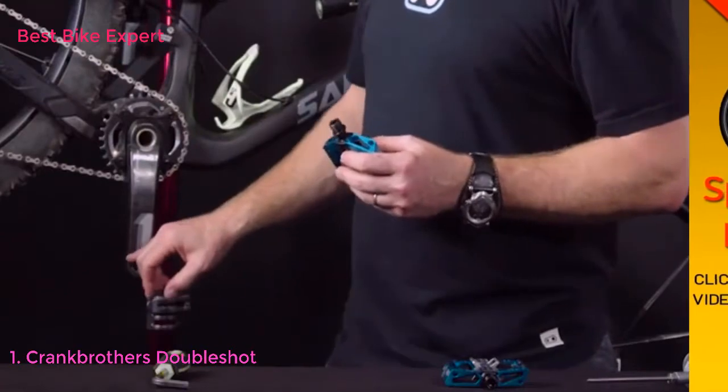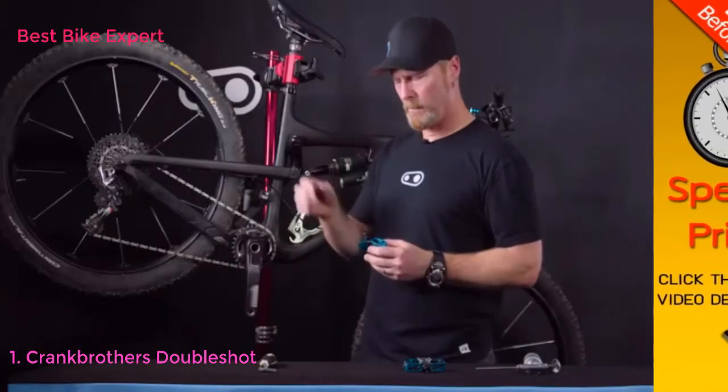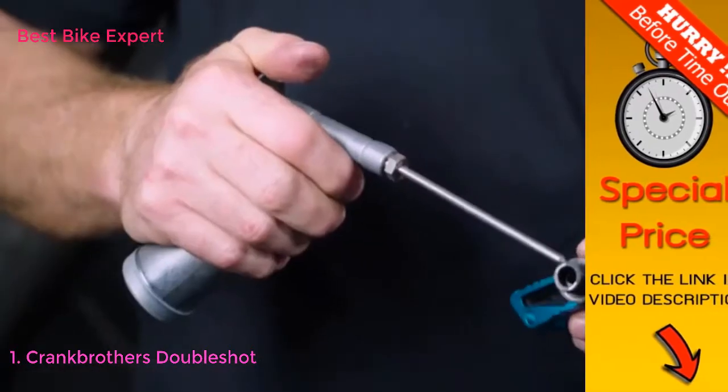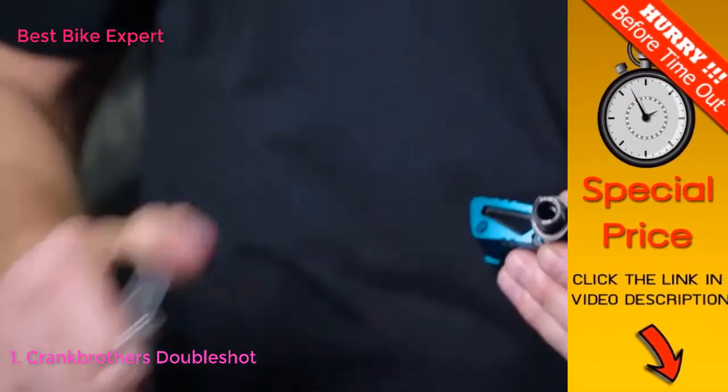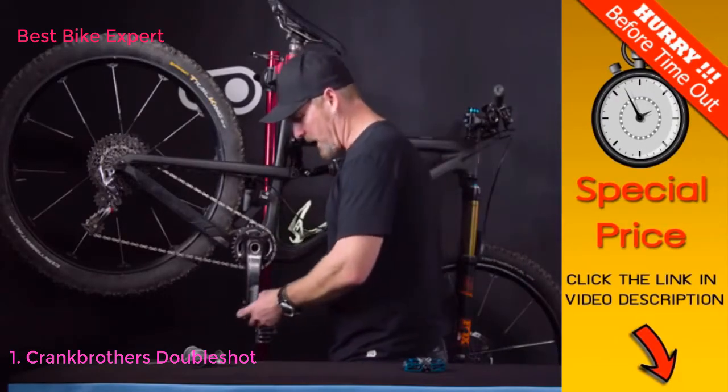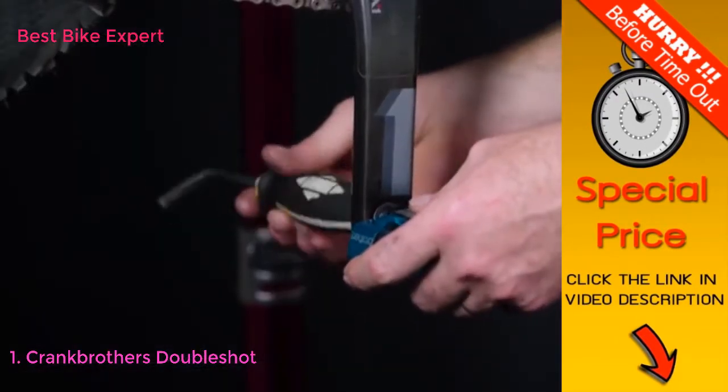Check with the manufacturer and see if they use pedal washers or not. If they do, install that first. Go ahead and apply a little bit of grease to the pedal threads so we get the proper torque. And then a little rule of thumb that we like to use here at Crankbrothers is an over-the-top and towards-the-front technique as far as the wrench turning direction.